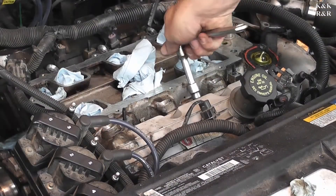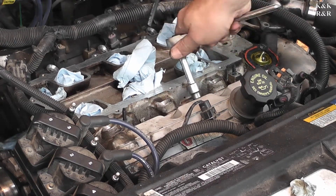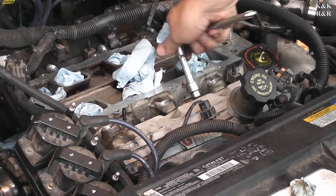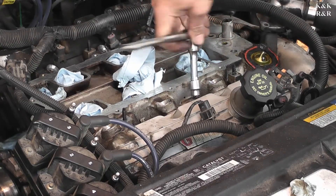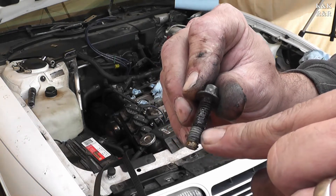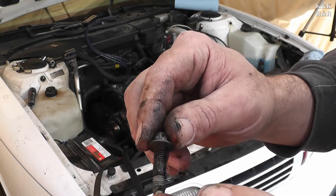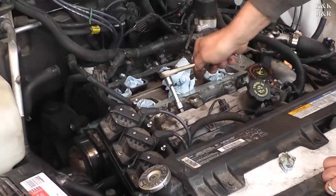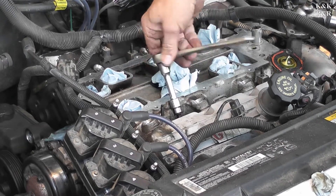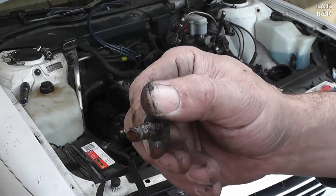One out of eight — let's go. Now if you get one that feels tight, stop and go back in with it, because some of these do have thread sealant, and they will when they go back in. Let's see if this one's wet. You can see on this bolt where it's dry, but this is where the antifreeze-oil soup mix got in and destroyed the sealant — this should all be sealed. I think everyone's going to have a different story. Just to illustrate the point, the lower intake gasket is definitely bad. This bolt coming out is pretty grimy, probably the worst one so far. Contaminated — there should be no liquid on these bolts. Each one of these bolts is going to have to be recleaned because they are reusable.